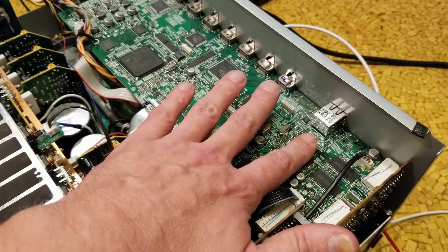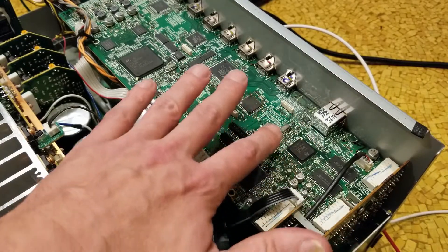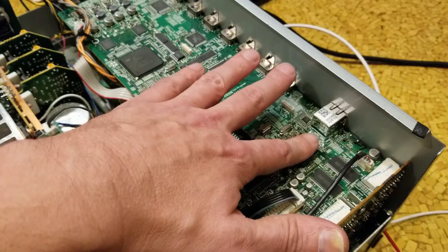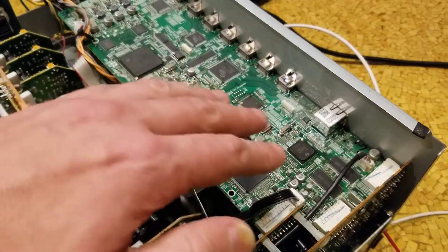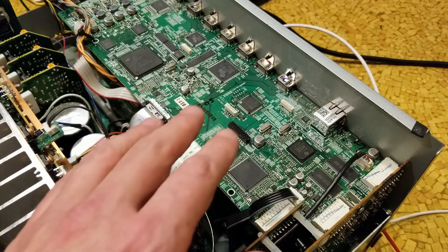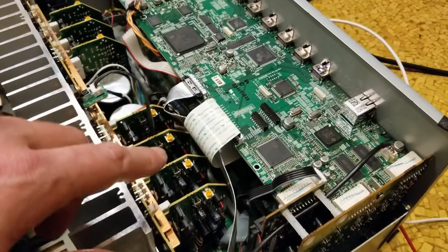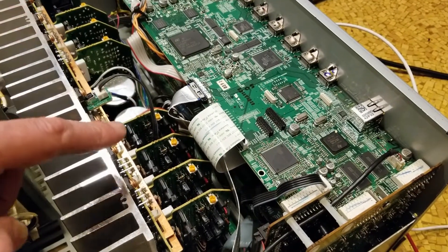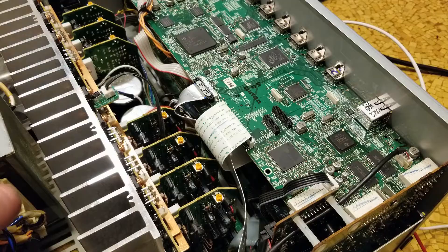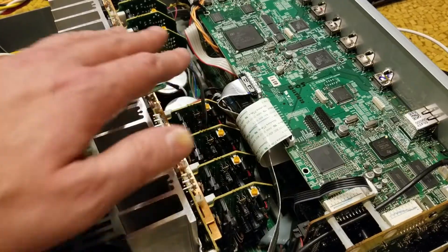It's surprising how hot it is already. It may be that when I actually play a movie with full-on 7-channel multi-channel decoding, that's when this will really have an issue because it'll have to process much more information. With channels driven even in pure direct mode, the left and right amp boards are already at 125 to 130 degrees. So that's the source of the heat. The transformer itself isn't bad — that's what causes a lot of heat in the Yamaha I have.